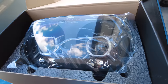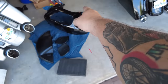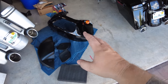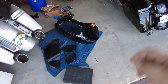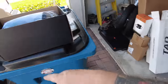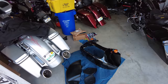I'm going to pull this out and mount the vent guard mesh light to this so we're ready to go back in the bike. Then we have to do the bullet turn signals on the outer fairing — that's just one screw holding those on from the back side. Another thing you're going to need, which I should have said, is some electrical tape, because there's tape holding that wire on the inside. You're going to need to re-secure the wire to the inside of the fairing. The foam tabs — you're going to tear them when you pull the wire out. And the last thing we'll do is those fang lights up top.